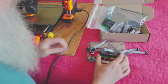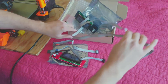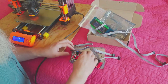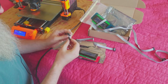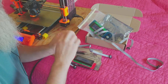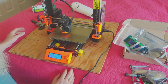Here are the two things I ordered. Here's the cheap one that I'm not going to use. One problem is these cables are really short compared to the official ones, which are really long as they should be. Also, if your problem is in the cabling, the short replacement cables are not going to help — you'd have to order longer cables. Someone also noted these connectors are unidirectional with a little tab, and I believe for the cheap LCD you actually have to shave it down and flip it over. Don't quote me on that, but go do your research. I'm going to take the old LCD off and plug in the new official one, and make sure it's working before I reassemble it.